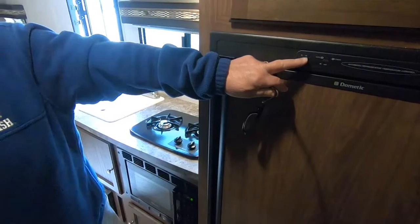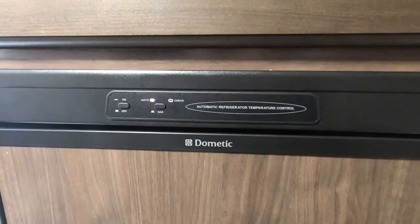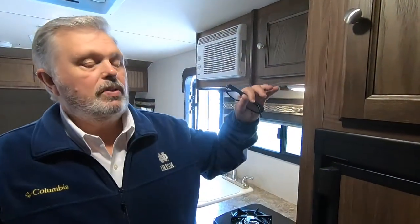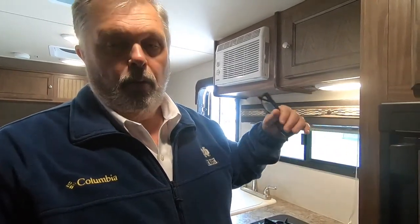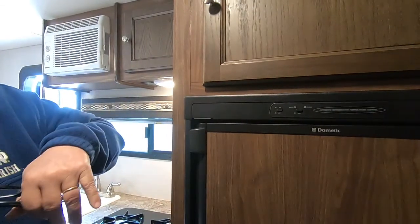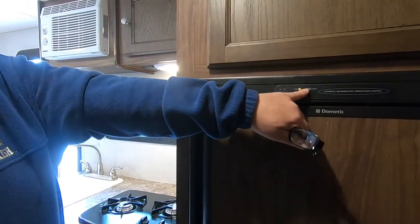Your table goes down into a bed — simply lower the table onto these rails, spread the cushions out, and you can sleep one or two kids there. Behind you we have an electric and propane refrigerator — simple on and off switch. Right now it's on automatic, which is where you want it. What automatic means is if the power goes out at the campground in the middle of the night, this will automatically switch to propane — as long as your tank is on. If the power comes back on, it will automatically go back to electric. If you're traveling and want the fridge full of food and drink, that's perfectly fine — it will run on propane. When you get to your campground and plug in, it will go to electric. You can force it to gas only by pushing that button, but 99% of the time you want it on automatic. It's hassle-free — you don't have to worry about it.